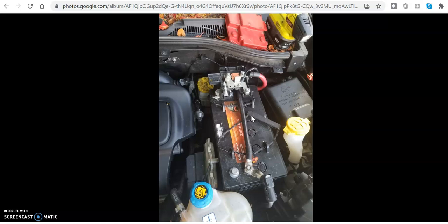If it's been raining all day or there's heavy usage, usually I run the engine at night before going to sleep. It cools off the cab, and also if I'm going to watch TV or charge up my electronics, it's always a good idea right before to run the engine a little bit, because it is being fed by both the alternator and that solar panel. This has worked very nicely. There have been no issues with this.